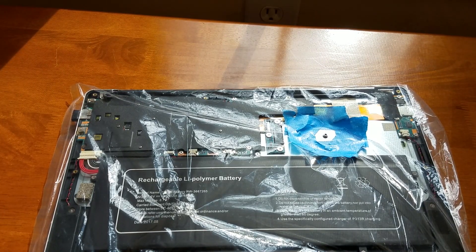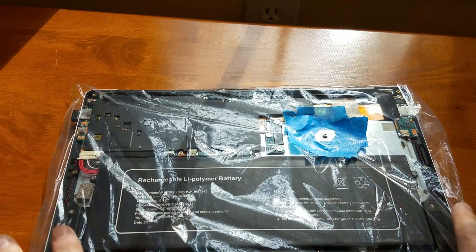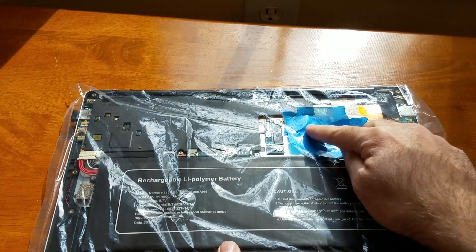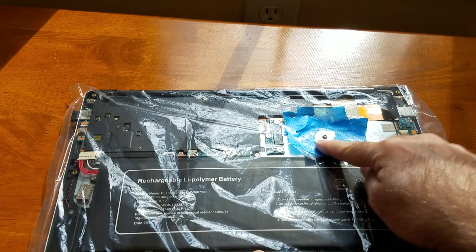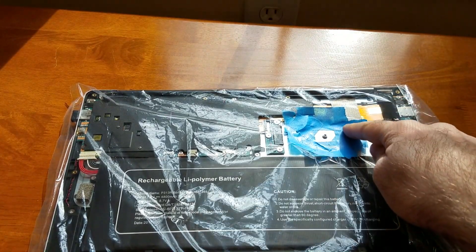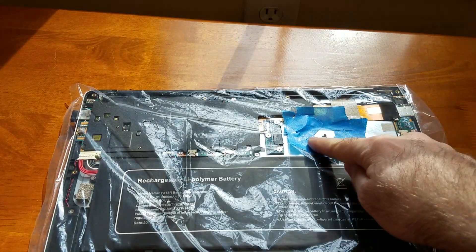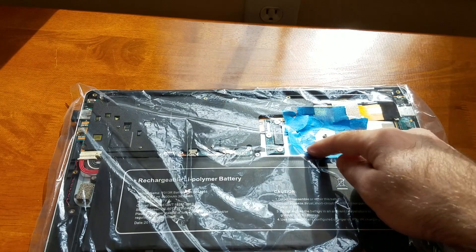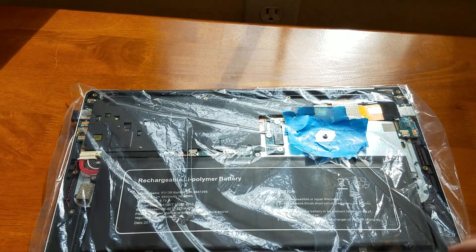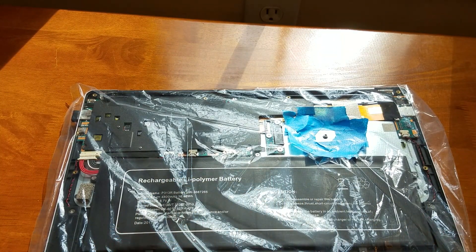What you want to have here ideally is a plastic bag or some sort of plastic that you can wrap the whole laptop with, and only make a small incision to leave a hole where you're going to cut. I used masking tape or painter's tape to tape around the hole so when you cut with the Dremel tool the metal shavings will not transfer over to any of the electronic components. That's essential — you don't want to short anything later when you plug it in.